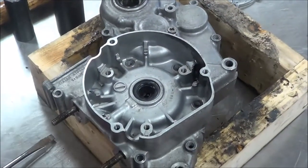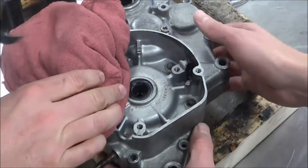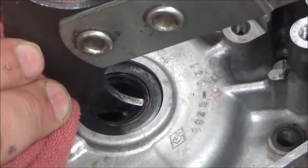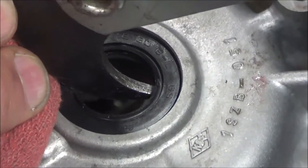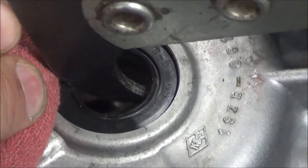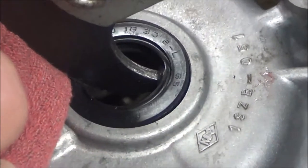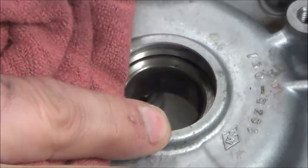Another thing you could do is go ahead and stack up a bunch of rags, and this is where we'd use our seal puller. I do not want to be so deep that I'm going to scratch. When you use this tool, just stick it in — right now I'm not deep enough, I'm only coming across the lip with the spring. So I'll move it in a little bit to get behind into the metal part, then pop it out. You can see it got that seal out — look in there, there's no damage. I did not scrape across the body causing any damage.